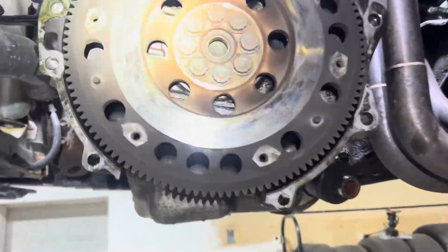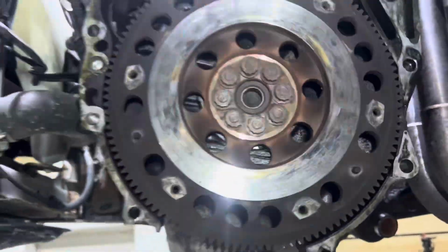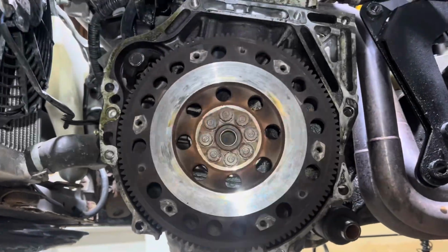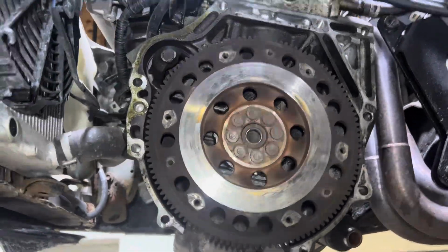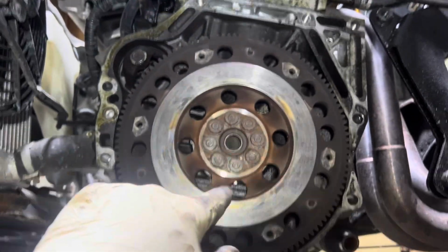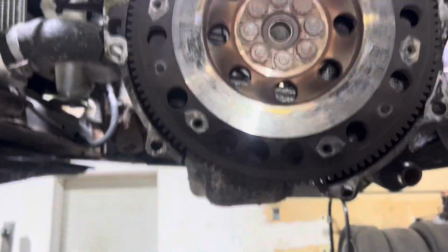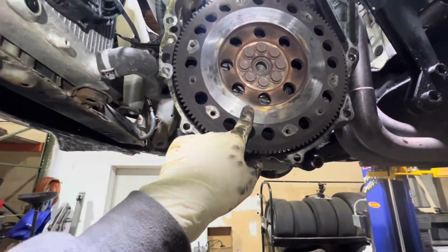That is really wet back there. You see that? So we might toss the rear main seal. It's not we might. We will toss the rear main seal on here. I at least stock 1 or 2 at all times. I mean, this thing's coming. The leaks are starting from up top too and working their way down. But since we're already in here, to get the trans off while doing a clutch job, you might as well do a rear main seal while you're in here. That's kind of like one of those things, you're already in there.